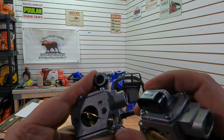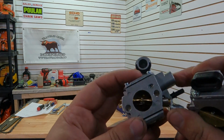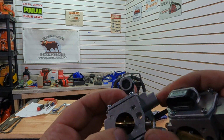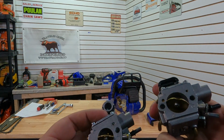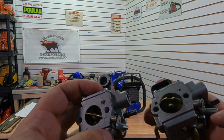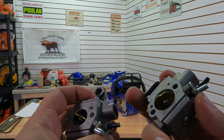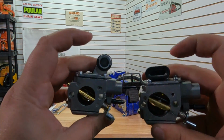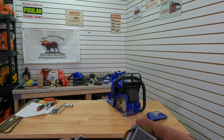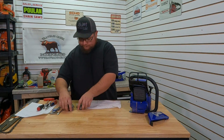And if we have to swap that choke rod out, luckily these are just the half rods. So we can pull this plate off, take the rod out, and then we just need to grind the flats a little bit larger to hold this plate. But we might also be able to get it to hit this anyway and make the choke still work. So we'll see what we end up with. But I'll get my Phillips, swap these plates around, make sure it is right, swap this plate around, make sure that's right as well. Good, nice clean working surface.